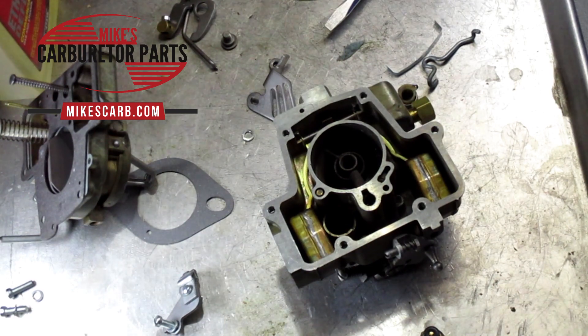If you went from sea level up to 5,000 feet, that's your break-off point. Anything over 5,000 feet your carburetor will probably run too rich and you'll need to lower your jet size by 0.002. Then check your plugs again — that's the best way.